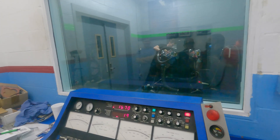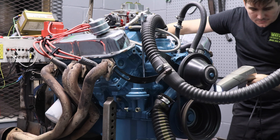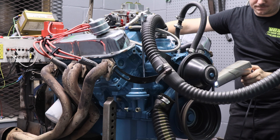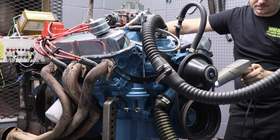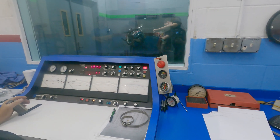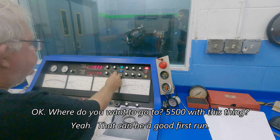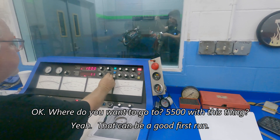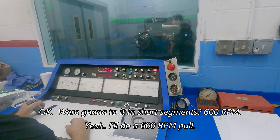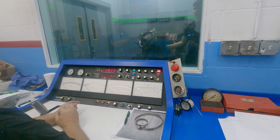It's a little quieter — not as loud as yours; yours had a lot more volume to it. All right, you get 32.3. What do you want to go to? 5,000? Yeah, that could be a good first pull. I'd maybe want to hit it a little lower — maybe 4,500. 5,500 is good I think. You're going to run it starting about 3,800. You're going to do it in short segments — yeah, 600 RPM increments. I'll do it with 600 RPM pulls.